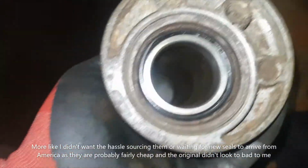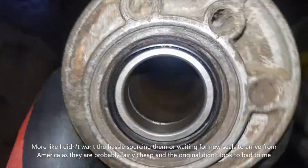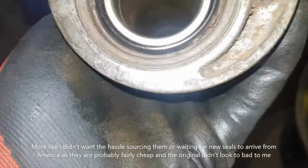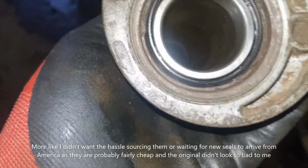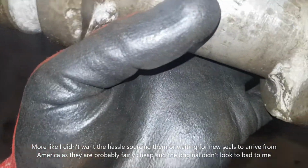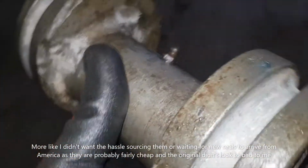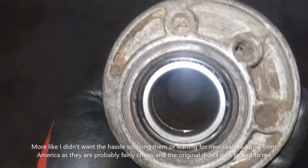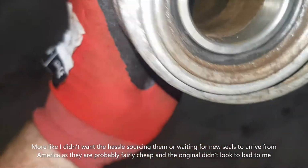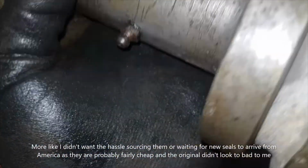There's a little piece of cylinder pipe inside that goes lengthwise, so I put that in obviously before I closed the other side. I put a grease nipple on it, and I have filled it up with grease as much as I can put in there, so I hope there's enough, and we'll see how we go from that.